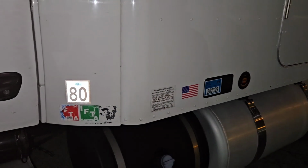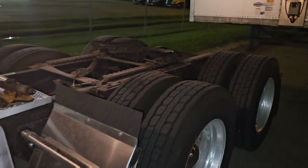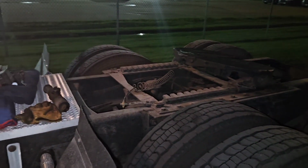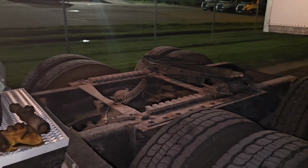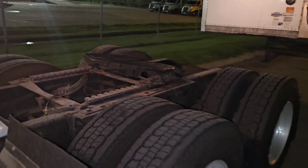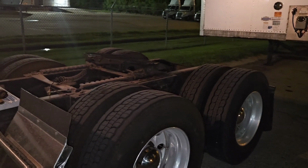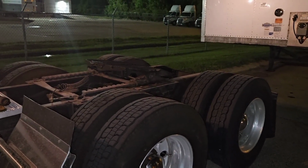Now, this is a solenoid, so it's supposed to click. It didn't click. There was no air. There was nothing. So I had to take that same air cylinder apart by removing the two bolts, pulling in those forks and pushing the fifth wheel all the way to the back. And then I put it back together and went on ahead and carried my load, and it was scaled properly.